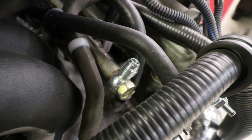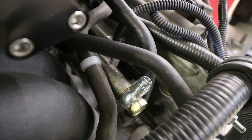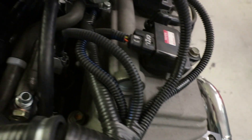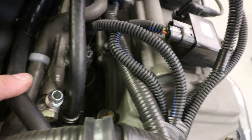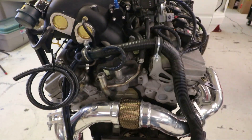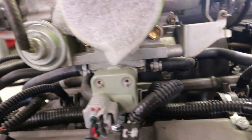At the back right-hand corner, passenger side of the fuel rail, we have the banjo fitting that's used for the Off-Road Solutions high-pressure fuel hose. If that hose is being used in your application, it's a great idea to have that banjo installed and set at about a 20 to 30 degree angle from straight up and tightened down ready to go. That way it's very easy to hook the hose to it — it's hard to access the back of this fuel rail when the engine is in the truck.